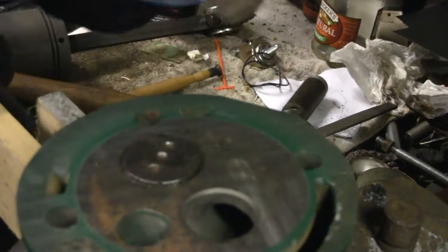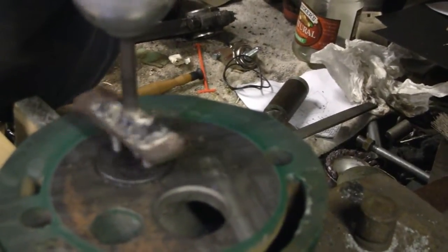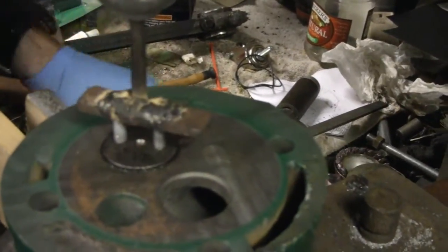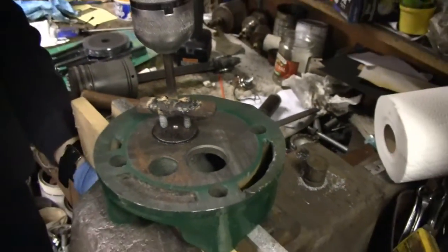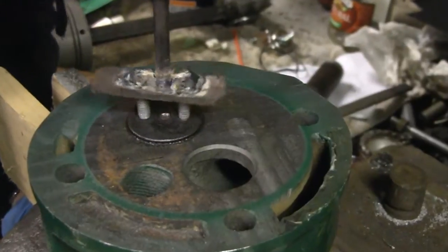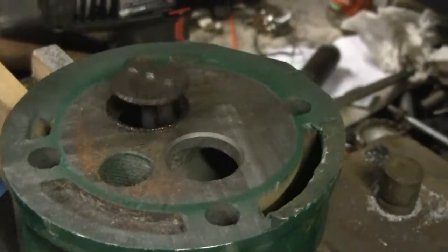Go one way and now he's gonna go the other way. I think the other valve has a slot in the head — they'll probably use a screwdriver or something for that. But it looks like it's gonna work pretty good. It worked just fine. Patting it down that way relocates the grit — lapping compound, whatever it is. Let's see what it looks like.